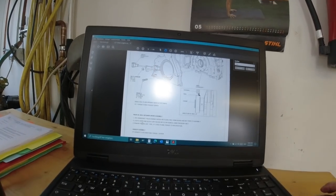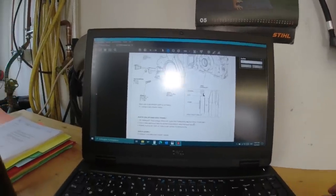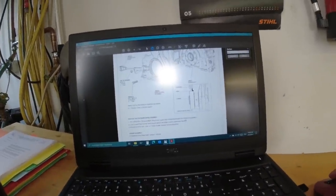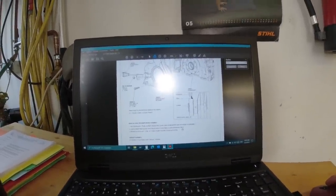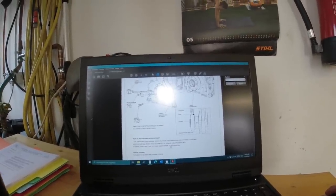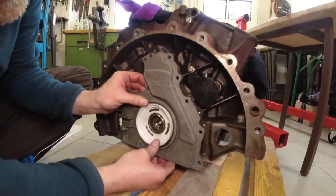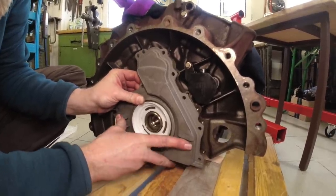The crankshaft journal should be clean, free from debris, and dry prior to assembly. So no oil. Hand pressure only. Remove plastic assembly tool. Fit 10 bolts and torque to spec. The plastic cap is like a funnel.